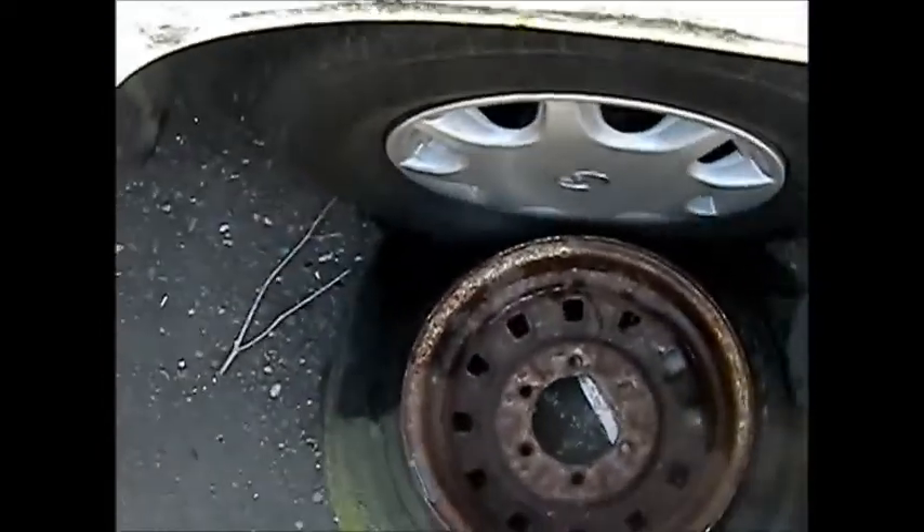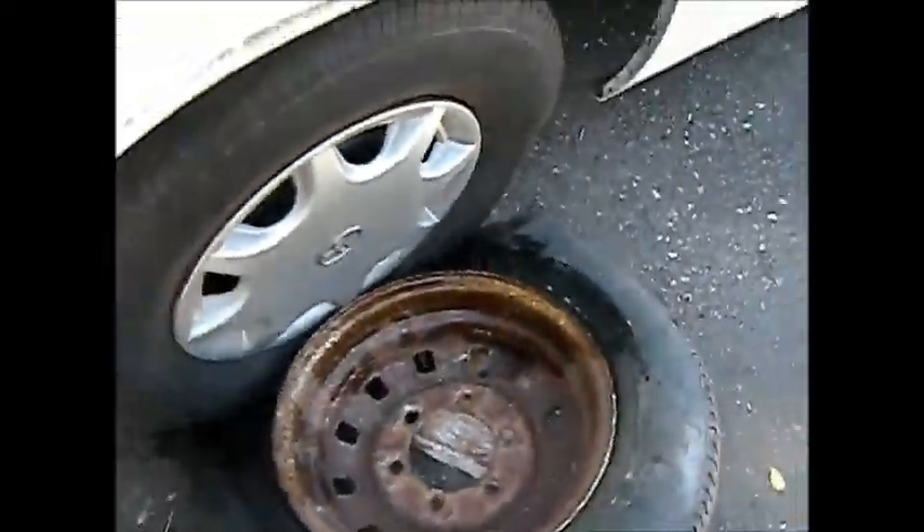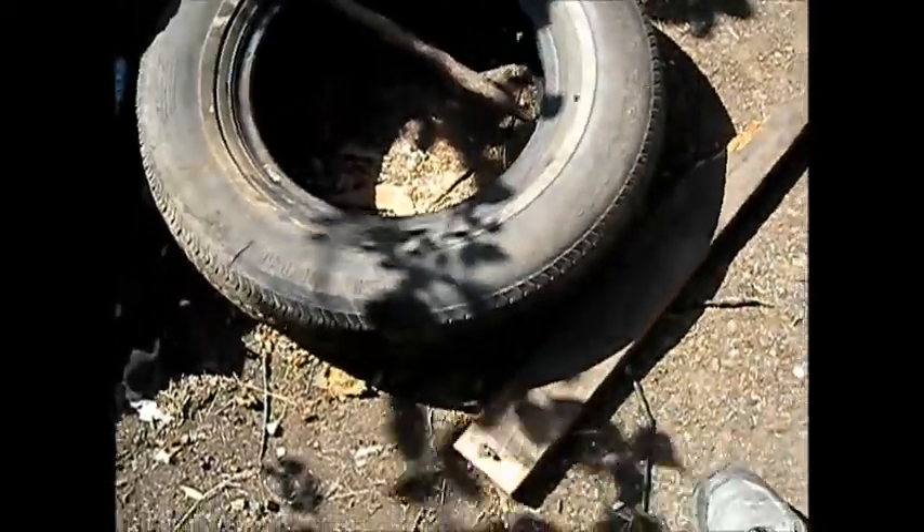You need to break that bead. I have a little soap around the edge here. It's almost busted, not quite. I'll probably have to turn it and then go and hit this edge here. That's how you break that bead, and then you can get your tire off.